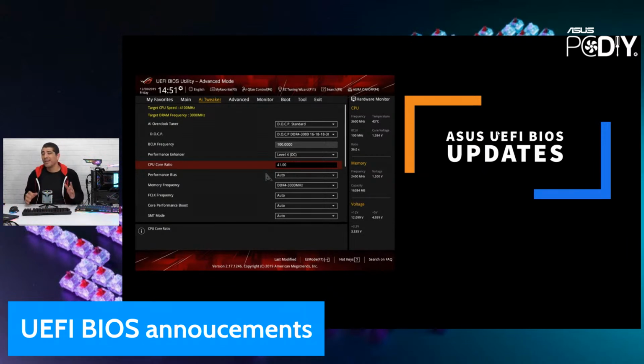and why you might want to keep them in mind. Now, I always stress, and again, if you want to know a little bit more, make sure to consider joining the group and check out the featured post that details all the information regarding what you want to keep in mind when you update your UEFI BIOS. If your system is running stable and reliable without any issues, there's no reason to update the UEFI. If you're specifically building a brand new system, then I do recommend flashing it to have that best baseline for interoperability, compatibility, and performance. But again, it's not a requirement.